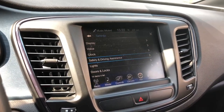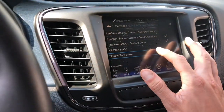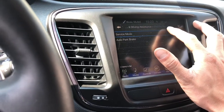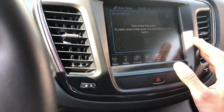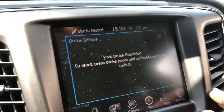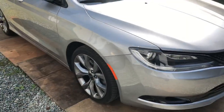When you're servicing your brakes you want to start here: go into your settings, go into safety and driving assistance, go to electric park brake, and then you can select service mode. I've already done it but it retracts the park brake — it'll give you a prompt to do so. This is the message that you get afterwards, so I'm going to go ahead and shut her down and start pulling the wheels.